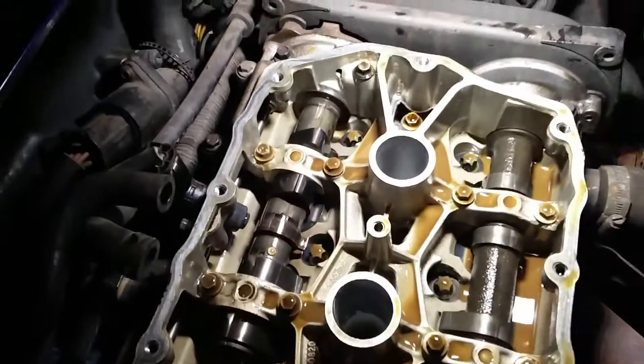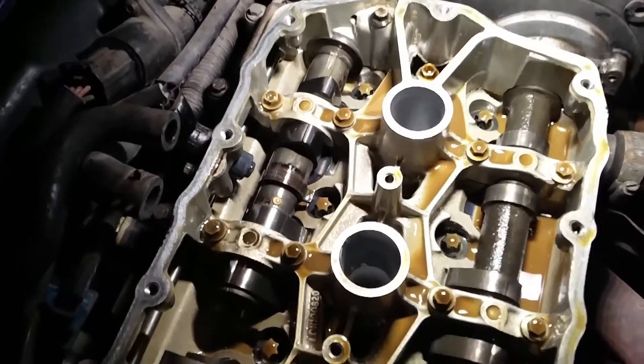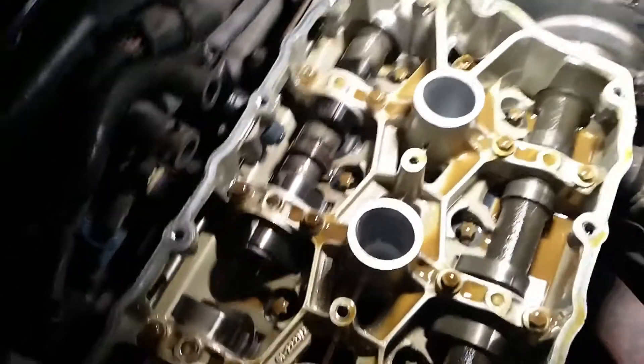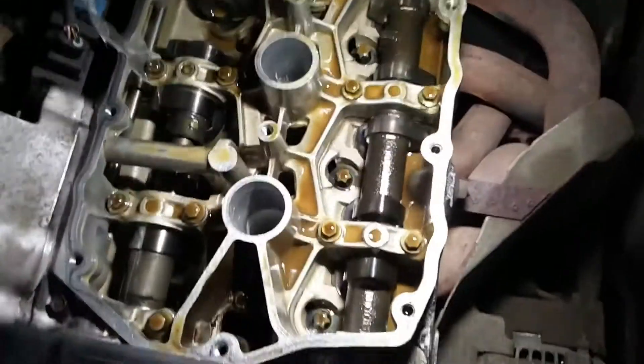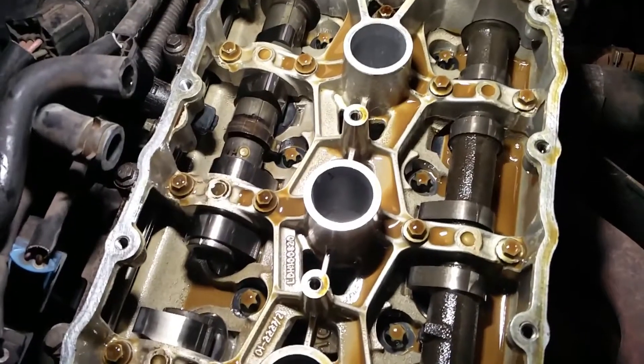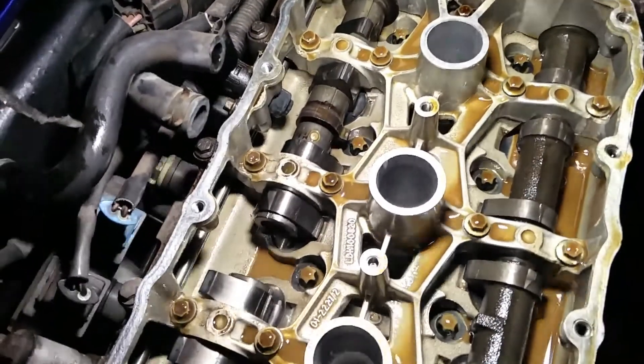I am going to get a better camera eventually so I can leave it on a tripod. So now it's: get the cam cover off, get the cam belt off — we'll inspect the cam belt but it will go back with a new one. Get the manifolds off and then it's head off. It's not really a bad job and there's loads of access. It's quite simple — not like a modern car, which is a real stress.